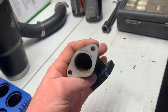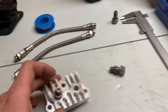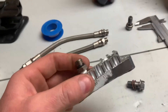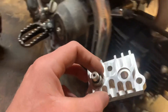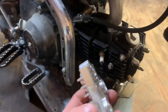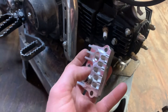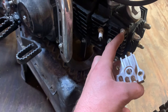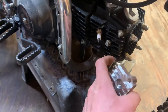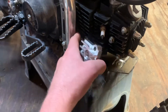I'm going to try and utilize the old intake manifold as well. Right now I'm just kind of playing around with these. This is the oil plate that attaches to — it's for an oil cooler, but I'm going to use it for the turbocharger. I actually have this in the wrong hole right now. This one is going to go up here because that's where the oil pressure is — it comes up through that gallery. And I believe this one is the drain, the feedback drain to the crankcase.